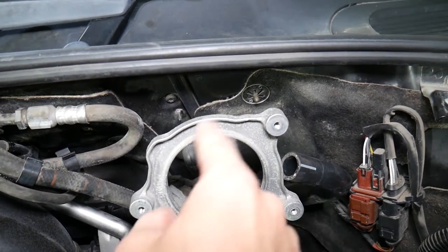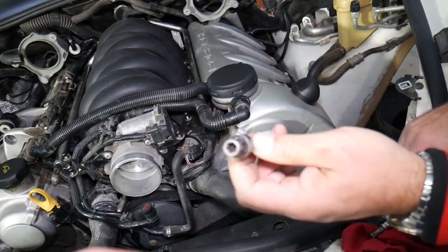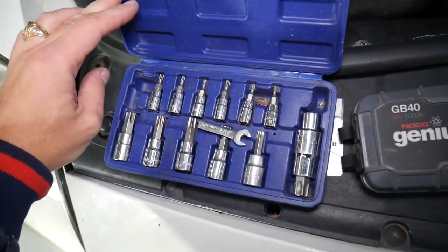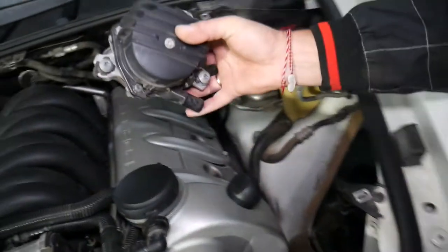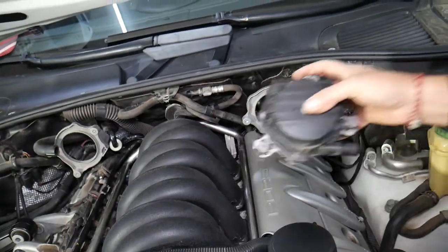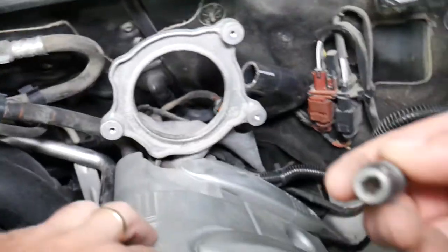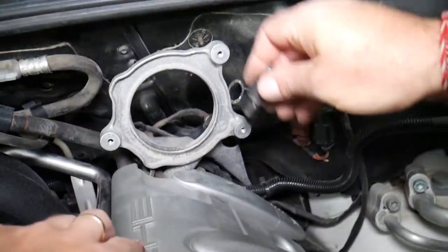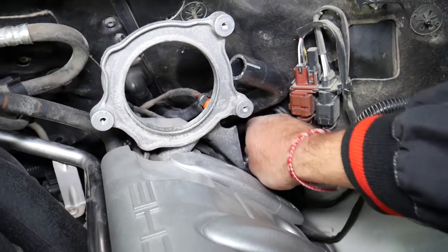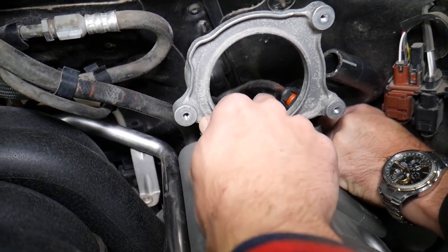After that, you need to remove your secondary air pumps. You have only three bolts. Let me show you what it looks like — the bolts for the pump are Torx. You have to remove three bolts, remove the hose, and disconnect the wire. After that, we'll need to remove the mount for the pump itself. It uses a reverse Torx socket — we'll put the links in the description below. It's a very limited amount of space, but we'll show you how.